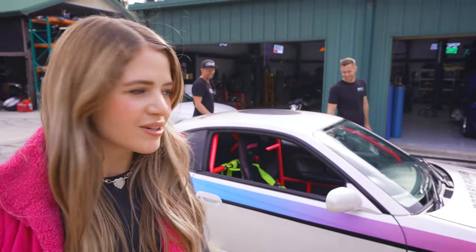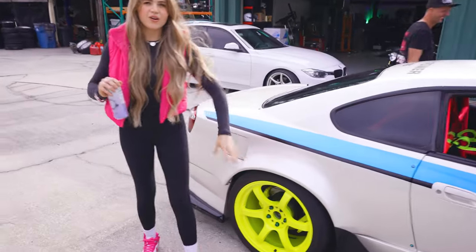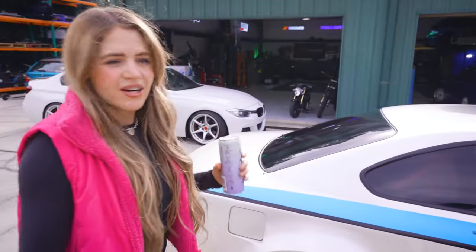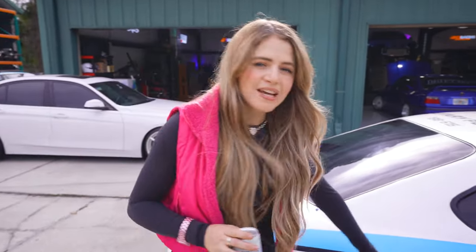And that EXO coating is really gonna help in the rear here with all of the tire rubber that always gets chunked up, goes across your car and leaves black stains. That's something I actually wish that I would have done to the Corvette. That's my biggest regret, because even though it's bashed up, the paint itself is stained just from rubber, tire, and smoke. So EXO is something that you guys can get and do yourself at home. That's something I will highly recommend, especially for a drift car.